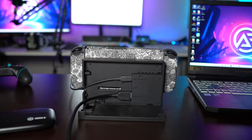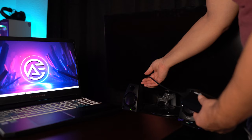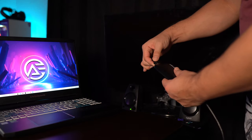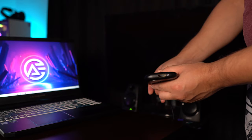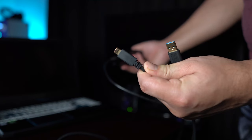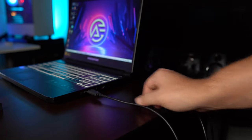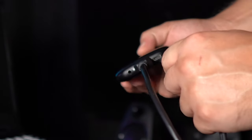Okay, so we got the gear out of the way. Let's jump into how we set this up — starting with the cables. The HDMI that comes from your console: plug that directly into the HDMI in port on the capture card. Then take the HDMI cable that would normally be plugged into your monitor and plug that into the out portion of the capture card, and the other end into your monitor. Next is the USB cable — it has one USB-C side and a normal USB 3.0 on the other side. Plug the USB 3.0 into your laptop and the USB-C side into the capture card port.